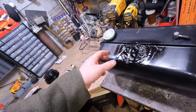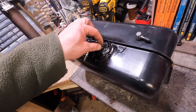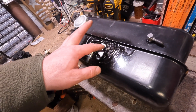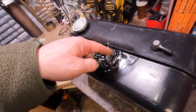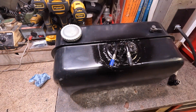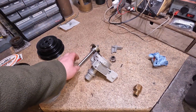Another thing — the fuel tank is kind of welded up and tested. The only thing bad was on the TIG weld I had to keep trying to cool down this plastic little insert so it didn't melt — it started to melt and I threw a couple wet rags on it, which is why it's a little bubbly. I pressure tested it when done; had to braze around some of these tubes, and there was a little air coming out of the plastic fitting, so I just glued it and painted it and it'll be fine. EFI and carbureted fuel tank all in one.